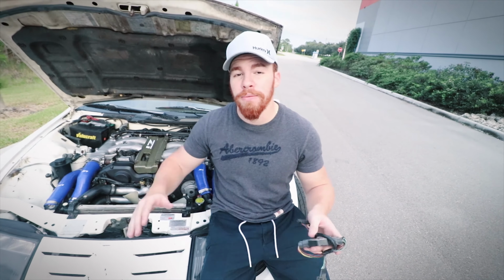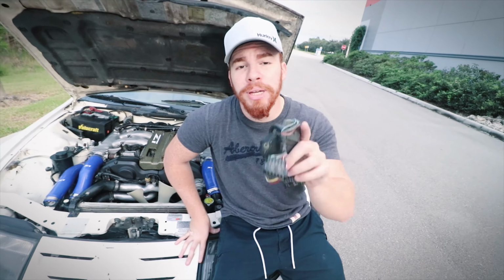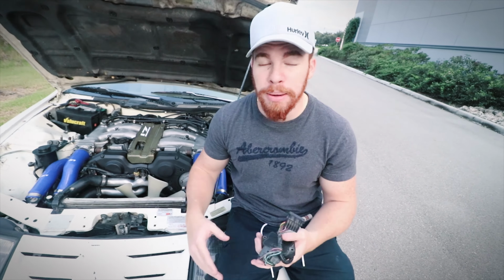These VGs are very, very complicated engines, so you do not want to cheap out on them. Also, the first thing you should ask the owner is if the 120K maintenance has been done on it. I just recently did it. My car currently has 180,000 miles, so it was very, very off. The timing was off. Everything was pretty bad. So thank God that I did that.